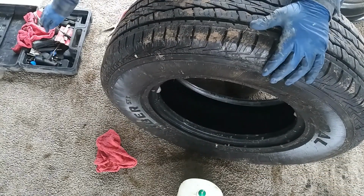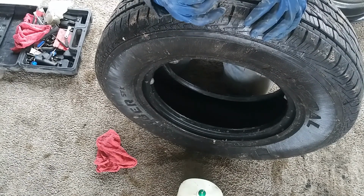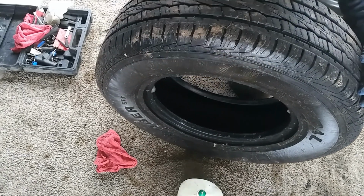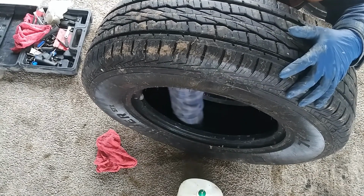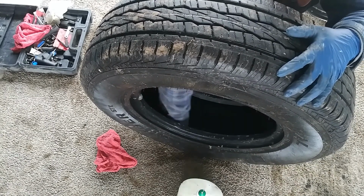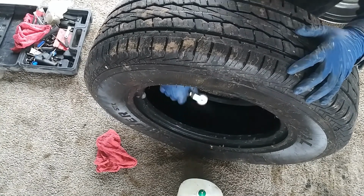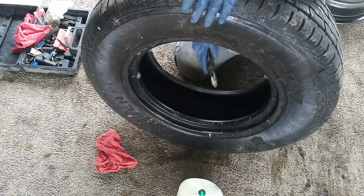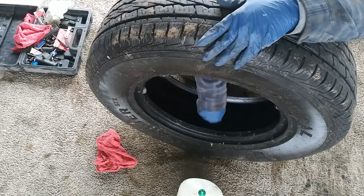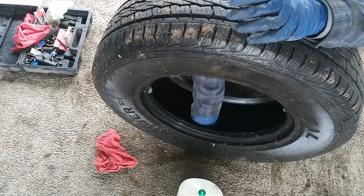And now you're also going to need this. This is the patch stitcher 3000. We're going to use this to stitch that patch in. We're going to start from the middle and work your way out to one side, then start from the middle and work out to the other side, and then go lengthways and widthwise, just to make sure it's all nice and flat. We start from the middle so that if there are any air bubbles or excess glue, we'll stretch that out.